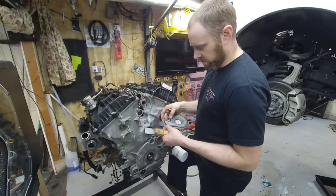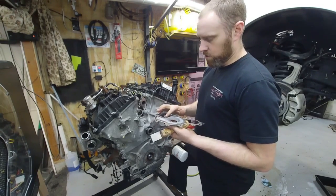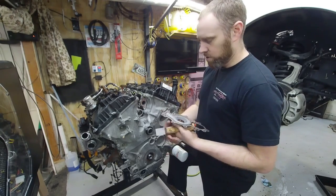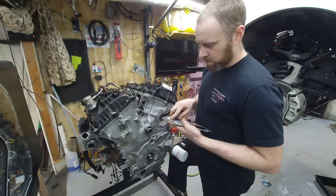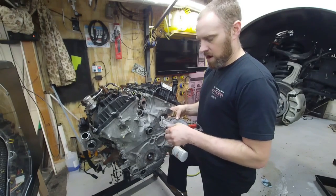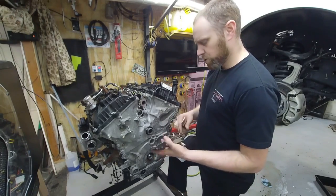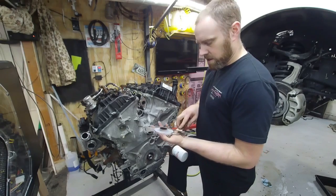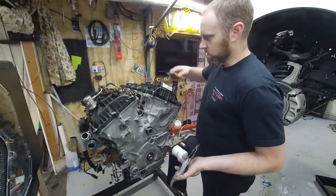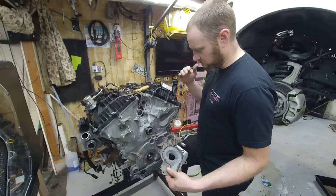This is an embossed gasket, meaning the rubber sticks out beyond the metal — you can feel it very obviously. This gasket is actually not shot; I could just replace it and it would be fine, but I'm going to reuse it. I'll take a little wire brush and wipe off some of the corrosion — you could use baking soda, whatever — clean it up, get the corrosion off, put the gasket back on and you'll be good as new. You don't have to replace it if you don't want to; I have no reason to on this job.